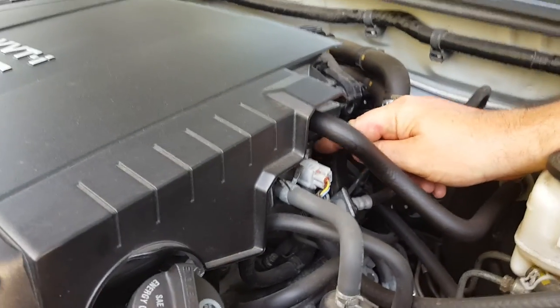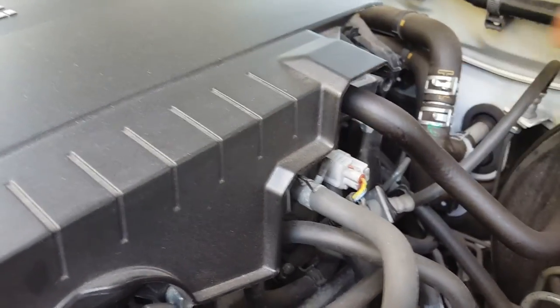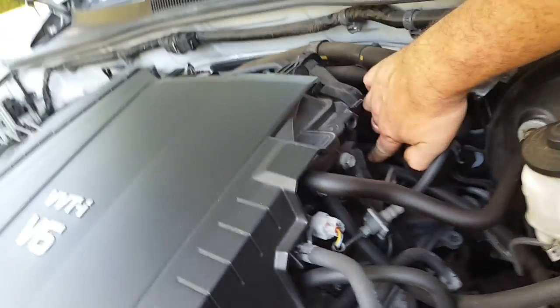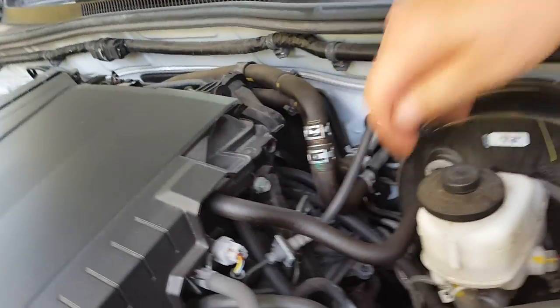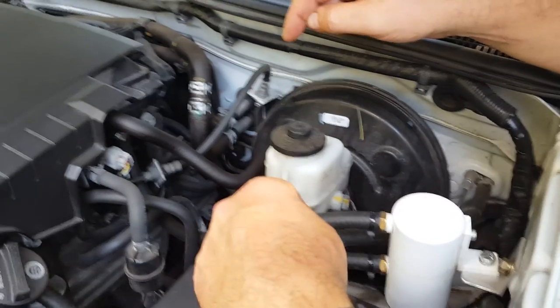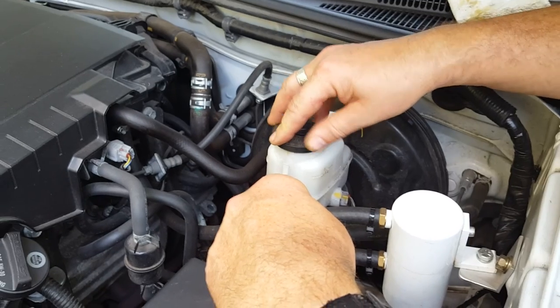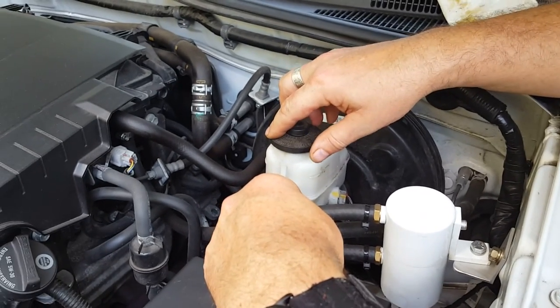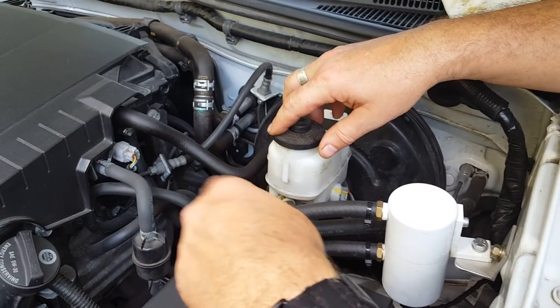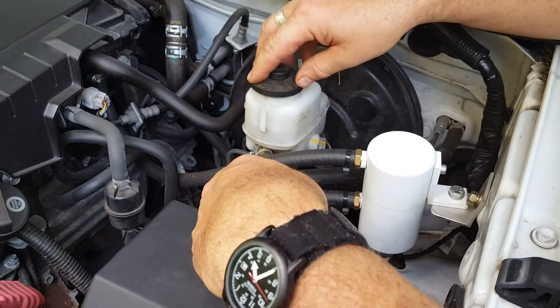On the Subaru I had found some oil residue, but on this one it was dry, which led me to believe something was going on with the PCV valve. I removed the PCV valve — it was down in there — and it was kind of cooked up. I cleaned it with carburetor cleaner and freed it up, and that pretty much took care of my oil usage problem. The PCV valve had been stuck, causing crankcase pressure to blow by the oil rings.